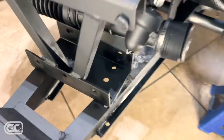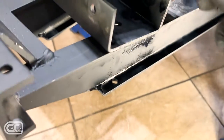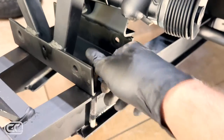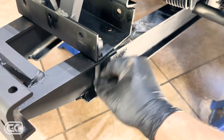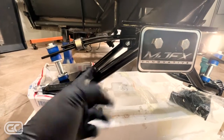Really nice quality — GCMod.com. Back at the cart, I've got my four bolts that came out of here. I don't really want to use the old stuff but I don't have time to go to the hardware store, so I'm putting them back in. Remember when you loosened all this — this whole armature is now loose, so slip these back into the frame. You're going to put a jack underneath to stabilize it and tighten up your nuts. I'm using the styrofoam from the box just to hold it in place to get the first nut started.